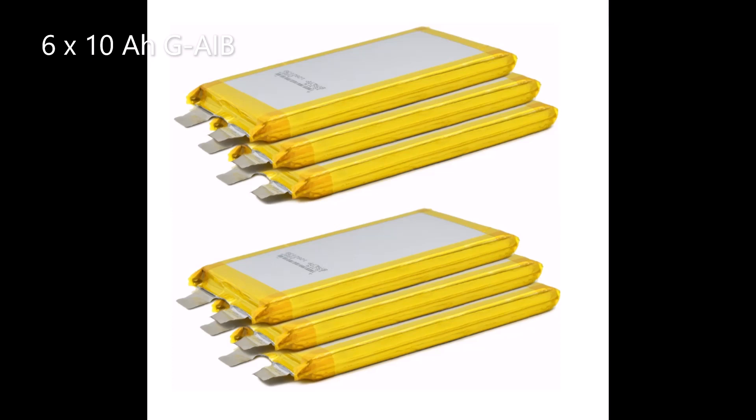The rest of the crank cycle is a short 200 milliseconds of 300 amps, then 200 amps for about 2 seconds. This averages at just over 20C for this battery. This shows that a mere 10 amp hour GMG Graphene Aluminium Ion battery will easily start a car. Not only that — it will continue to do these crank cycles without being charged perhaps 50 times. Try that with a lead acid battery. We have seen that these cells can perform 2000 cycles at these elevated C rates, so it is quite possible that these cells will last for the lifetime of the vehicle.